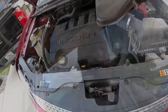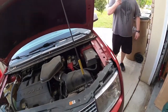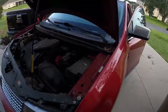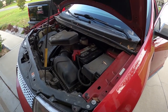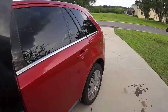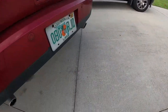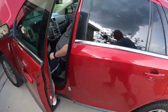Here's the new part. We're just going to replace the one coil pack we swapped. The part literally took two minutes to put on because it's in the front. Starting it up — oh, that sounds so much better! Yeah, that was the problem.